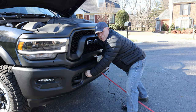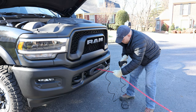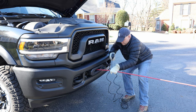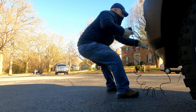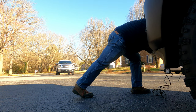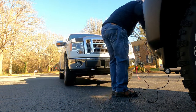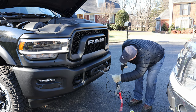You do want to push this lever up into the lock position — it was down, so now it's locked — and then you can start spooling. I want to mention that what I'm going to be doing is standing in front of here and making sure the cable goes onto the spool nice and neat evenly. You never, ever want to do what I'm about to do, which is stand in front of your winch as that cable is going through. Because obviously if it breaks, it's going to come and hit you in the head and it's going to kill you or at least severely injure you. So what I'm about to do is purely for the purpose of pre-tensioning this cable — don't ever do this when you're actually recovering either yourself or someone else.